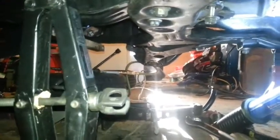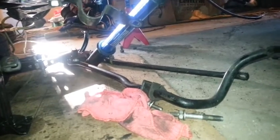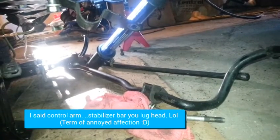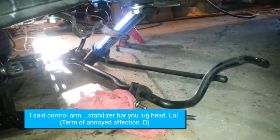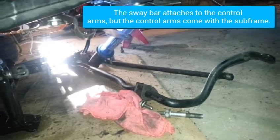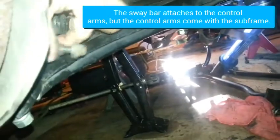These are just some strategies - the engine can go up and down to slide things into place. The big thing you don't have to do if you're only after the motor mounts is remove this control arm - I didn't know that before I started. It never had to come off. It's just as convenient that I removed it, but you don't even have to take that off to change end links.